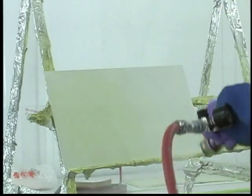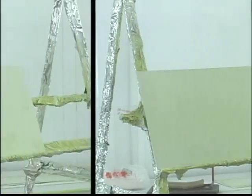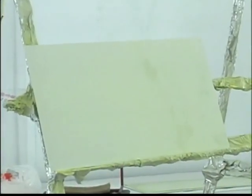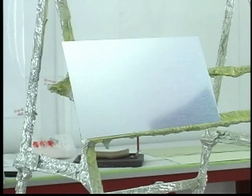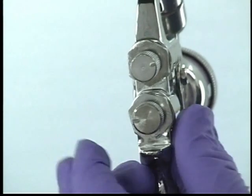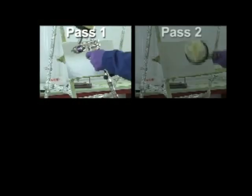As a criterion, one should achieve the target thickness of 0.2 mil in 2 to 3 passes. In other words, each pass should generate about 0.07 to 0.1 mil primer thickness. At high humidity conditions, thickness to build per pass should be reduced to 0.05 to 0.08 mil by adjusting the fluid control knob and increasing the number of passes to 3 to 4.